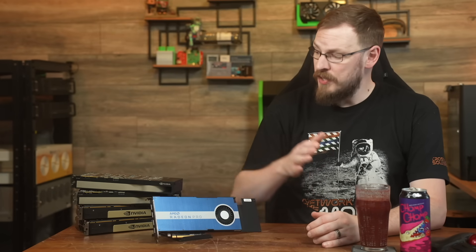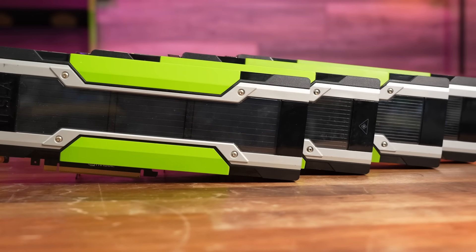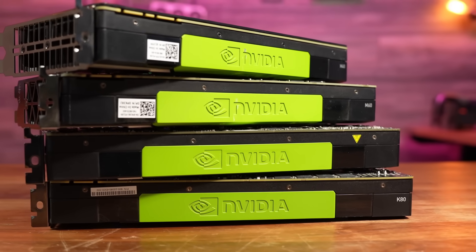There are two ways to turn your server into a gaming rig. Number one: install an enterprise-focused GPU with proprietary drivers to bifurcate them into smaller chunks, allowing multiple virtual machines to take advantage of a single GPU, often at the expense of both total performance and actual expense in money. Option number two is way more straightforward — slap a GPU into your server, pass it directly through to a virtual machine, and start playing games. And it's that second option that we're going to play around with today.